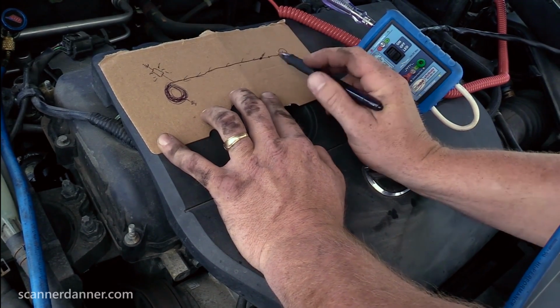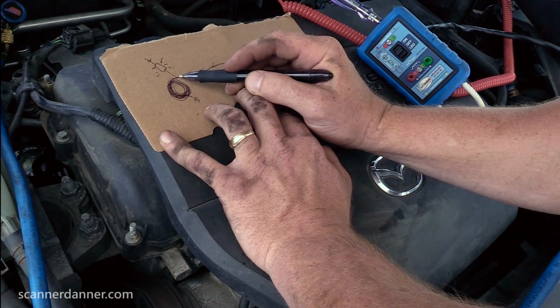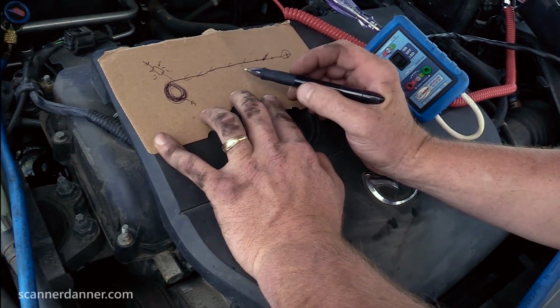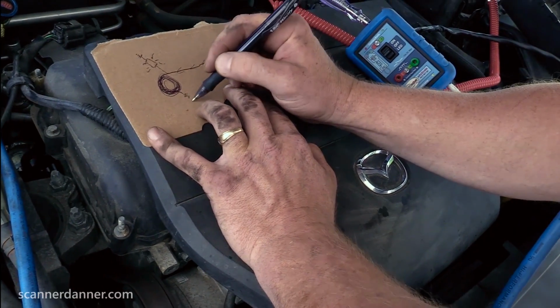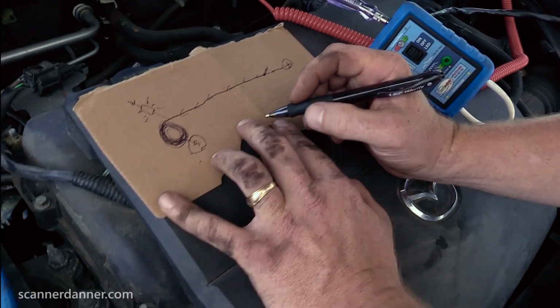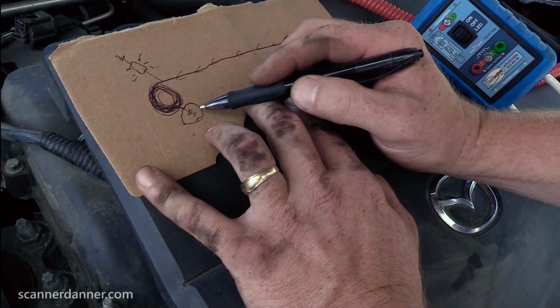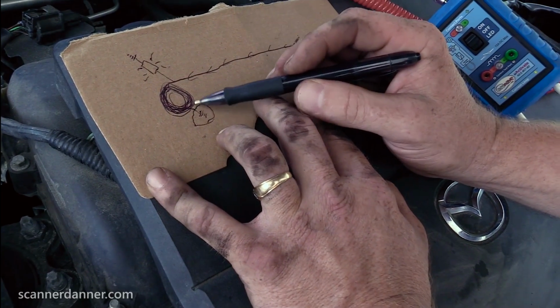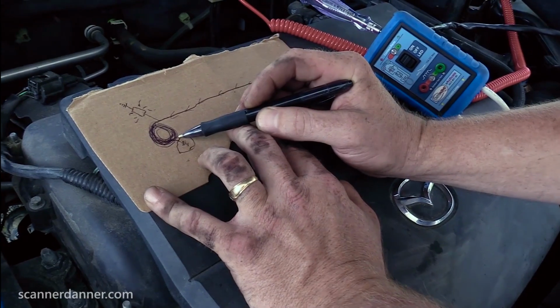How's my circuit from the relay box out to the clutch? It's good. No problem, no opens, right? Flood's not an issue. Now the flood could have damaged the clutch. We have to worry about this ground. Here's the thing. There's no ground wire. Oh. So the ground is on the housing itself. Yep, of the compressor. There's no test for that.